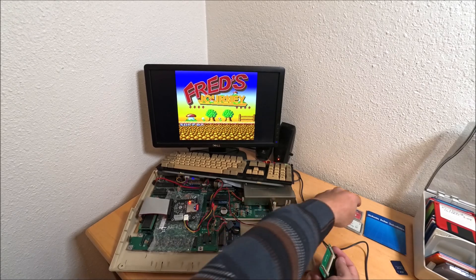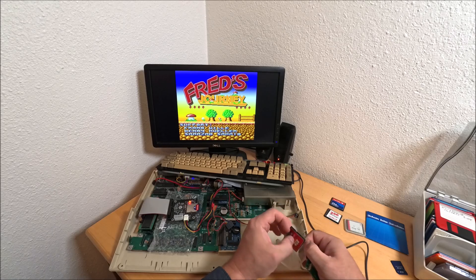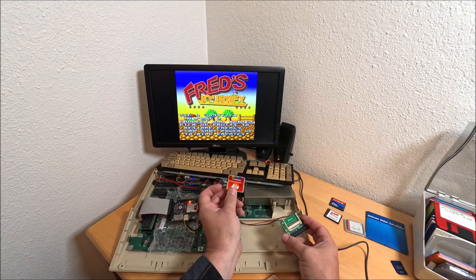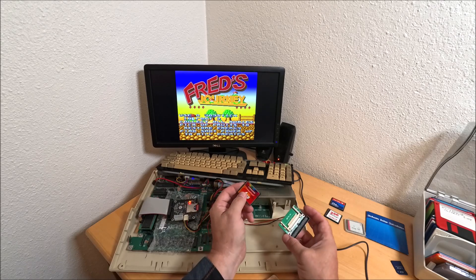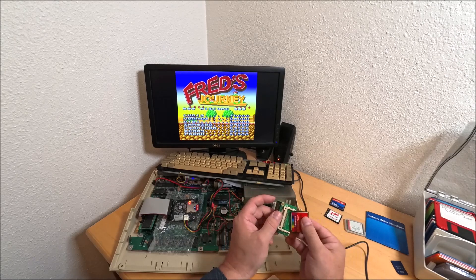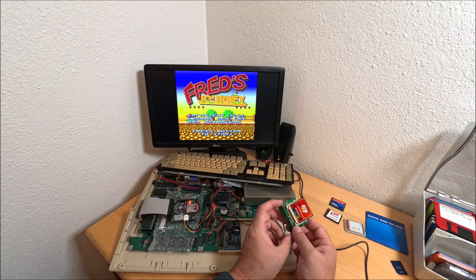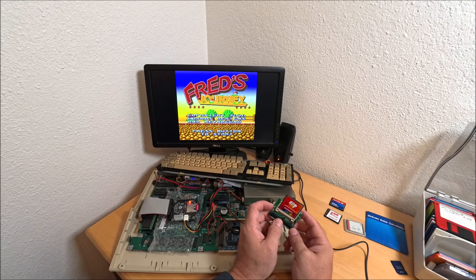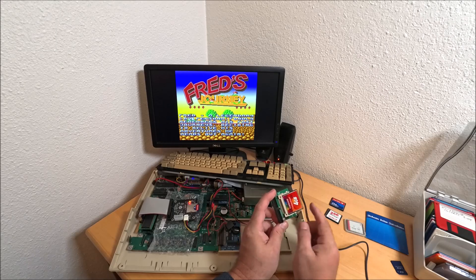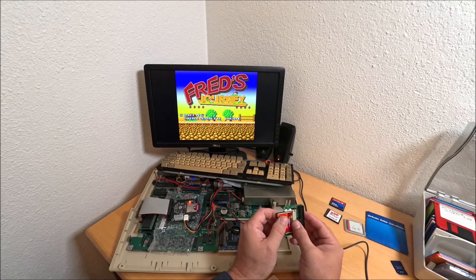When I first started using the card, I used my most trusted 4GB card by Transcend. I know this card works on other Amigas - on Amiga 3000, 1200, and 600 with no problem. I prepared the card on the computer first, then plugged it into the adapter. HDTools from 2.04 does recognize the card and you can make partitions, but then when you reboot it to format the partitions, it crashes and will not see the partition anymore.